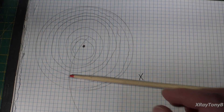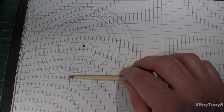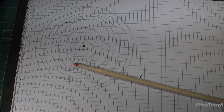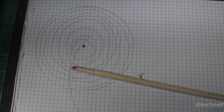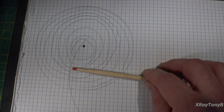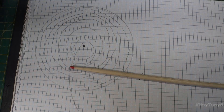You want it to track the center of the groove - you don't want it putting more pressure on one side than the other, because that cantilever moving back and forth is what makes your sound. That's what the anti-skating does. When you saw me turn that little anti-skating knob, it actually assures that as the arm goes in, the tension gets a little bit tighter and tighter and it counteracts the tendency for the stylus to want to walk in on its own. All these things come into account. There are different methods of setting those null points - they're named after the individuals who invented them. Each one has pros and cons, and people will get into all kinds of discussions over which is best.